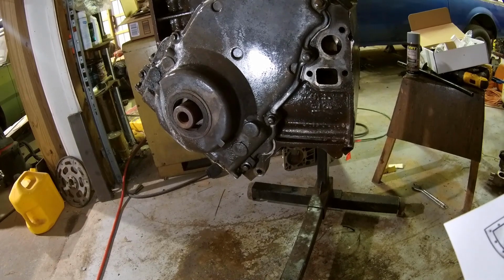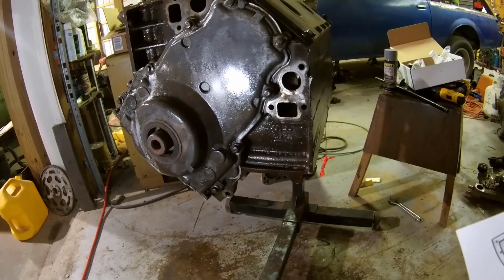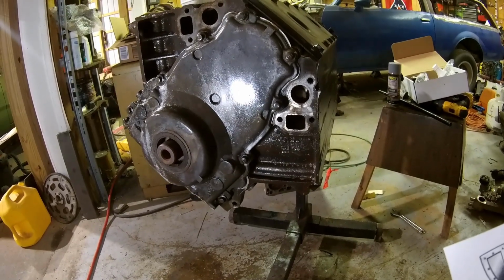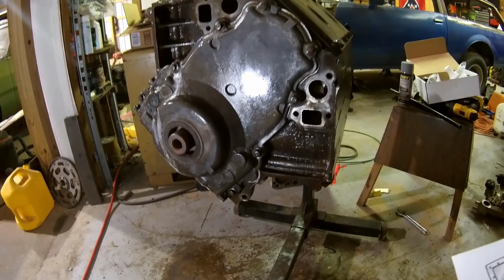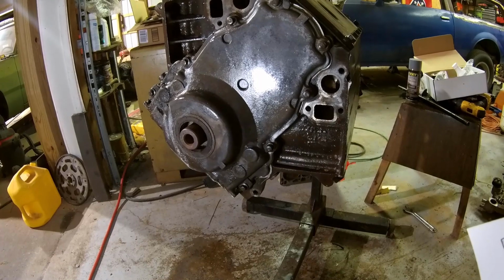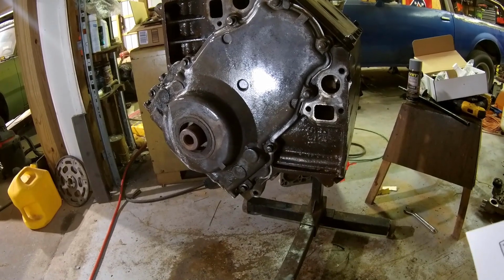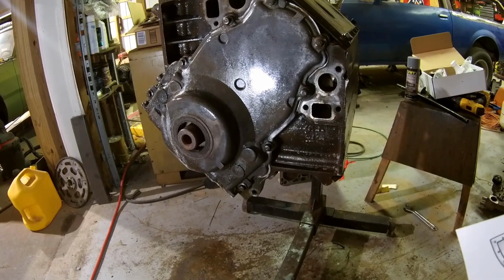Dilute 1:1 and soak until surface softens. So you can mix it up to 1:1, which I'm probably actually heavier than that. But wash clean area thoroughly and neutralize cleaner with water. POR15 cleaner degreaser is caustic high alkaline cleaner. Yeah, so it says coatings will not stick to alkaline surfaces.